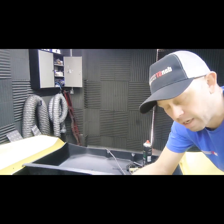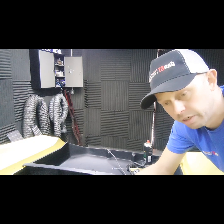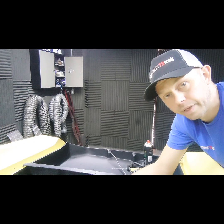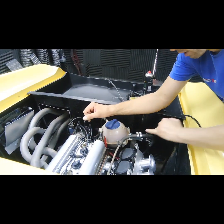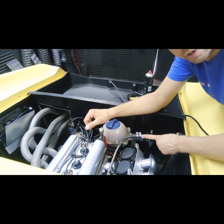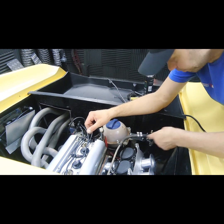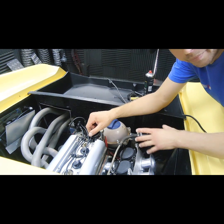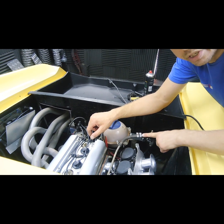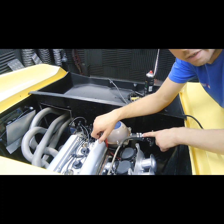The quick answer — well, there are two answers. Either you can make your fuel line larger going back to the tank and make sure it's going into the top, which may resolve it. But one of the quicker ways is to put a little restrictor into the supply line. As you can see I've got two hose clamps — we've broken the hose here and put an aluminium restrictor in there with a carburettor jet screwed into it. We couldn't get the pressure below 6 psi as it was, so we put this restrictor in with a 1.6mm main jet from these carbs, and that has brought the pressure down to the 3 psi that is required.